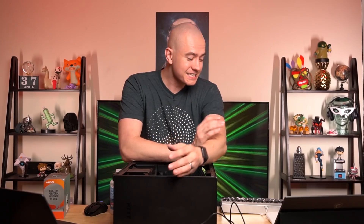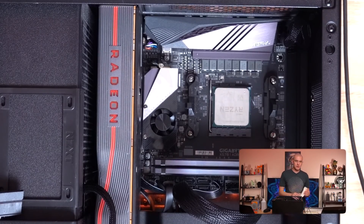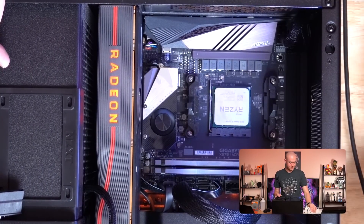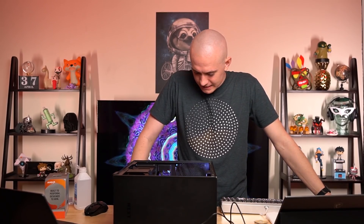Why am I doing this video again? This is one of the dumbest things I've ever done and we're putting it on the internet. This is one of those thought experiments where I'm like, hey, that would be so cool to try - if I had the disposable income. If all of these break, I'm not going to be able to replace them. Thermal paste cleaned off of the 3950X, I'm going to let it cool down. Then we're going to test my hypothesis that the CPUs were actually trapping the heat onto the 3950X. This is cool to the touch now - round three.